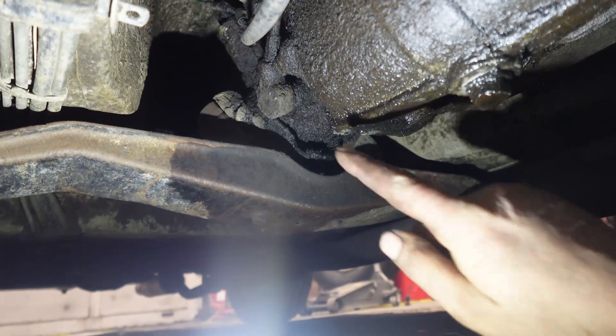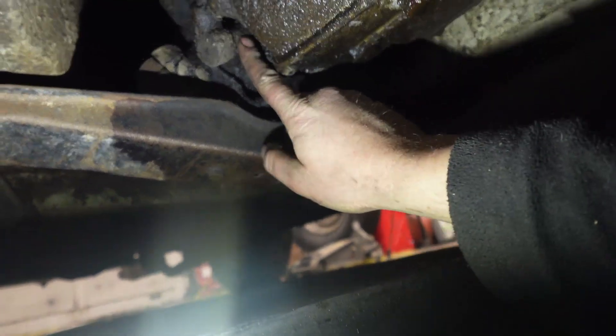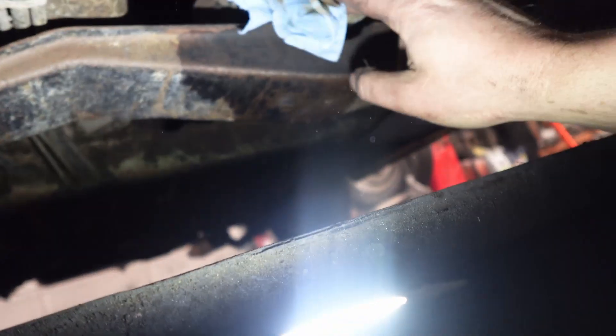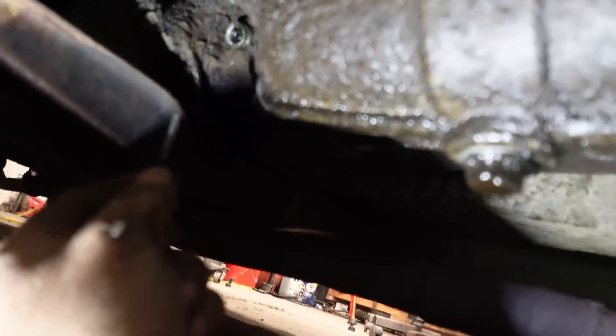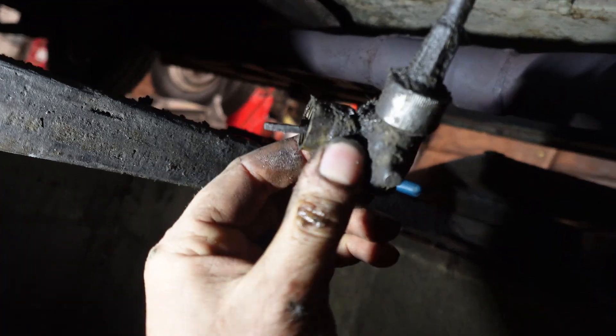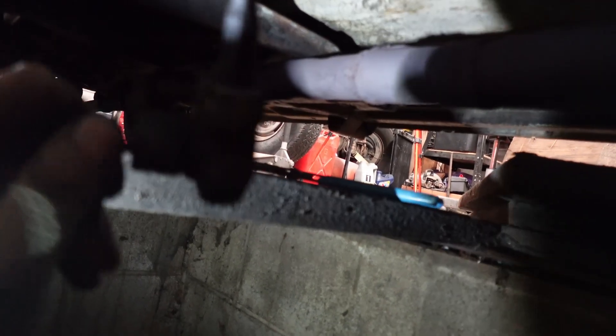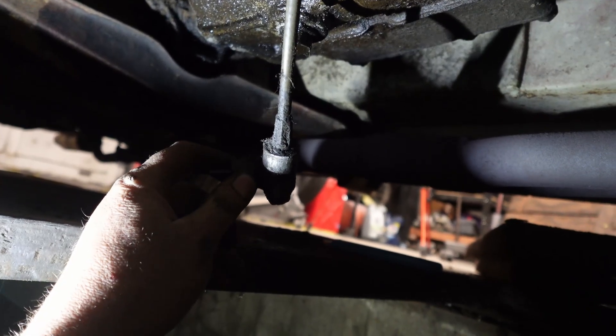I forgot just how gross it is down here, but this right here is the angle drive. I'm just going to clean that off a little bit, unthread it, and investigate. Just got it off — and just as I suspected, right there is part of the angle drive. That is the little piece of speedometer cable that's supposed to be attached in there, and it broke off. So really all I've got to do is swap that angle drive. I wish I'd done that without pulling the gauge, but I did have to pull the gauge to clean out that angle drive, so it's all worth doing.